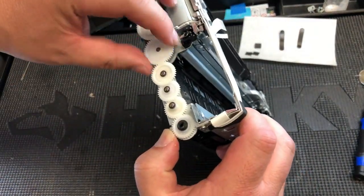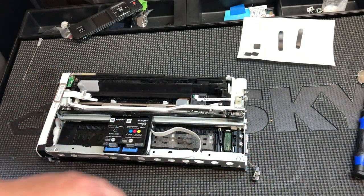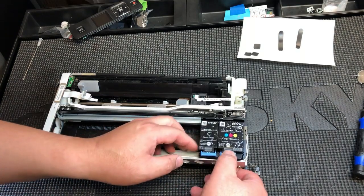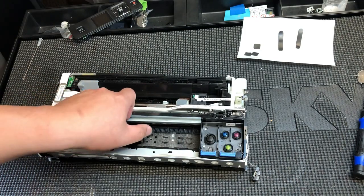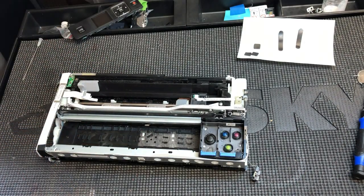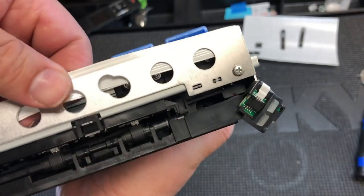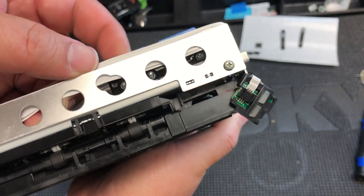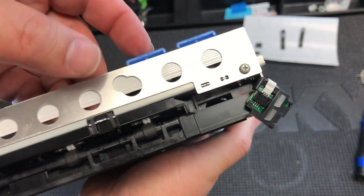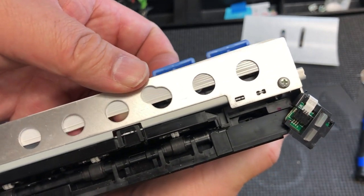Pick out the printer and turn this wheel — I believe it's clockwise. Now the print carriage is freed. Take the cartridges out, and after that, lift up the FFC cables — that's the wide flat cable. If you lift that up, you're going to see the tiny screws which you can access through those holes. Just move the cartridge around so you can unscrew those.